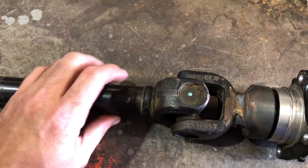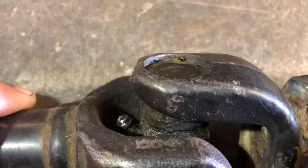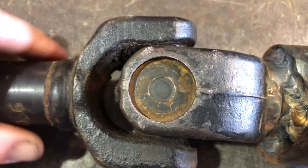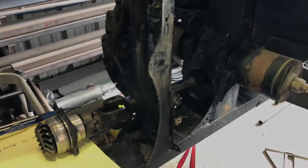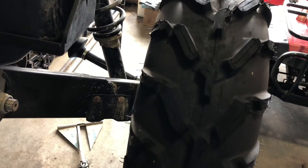I'm going to get a new U-joint ordered because this was a used bike. What are we missing here? There's no retainer. I don't see one on the inside. I definitely see one here, and I definitely don't see one here — I can see the groove for it. So this is just for mock-up purposes, but now you can see we actually have a drive shaft that can spin the wheels.